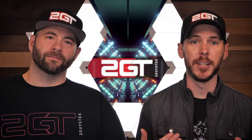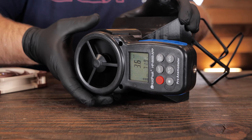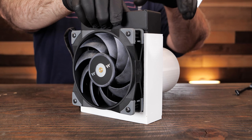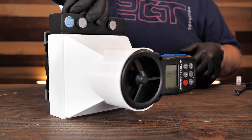To test this, we'll be using our standard fan testing protocol. First, we'll mount each fan into a specially designed 3D-printed duct to direct air onto an anemometer to test air speed. Next, we're going to test the same fans attached to a radiator, ducted through another 3D-printed housing. We'll run these tests at both full and half speed to give you an idea of how they compare. Then we'll take both fans and run them at full and half fan speed and measure how much noise they make, normalized against room ambient levels.